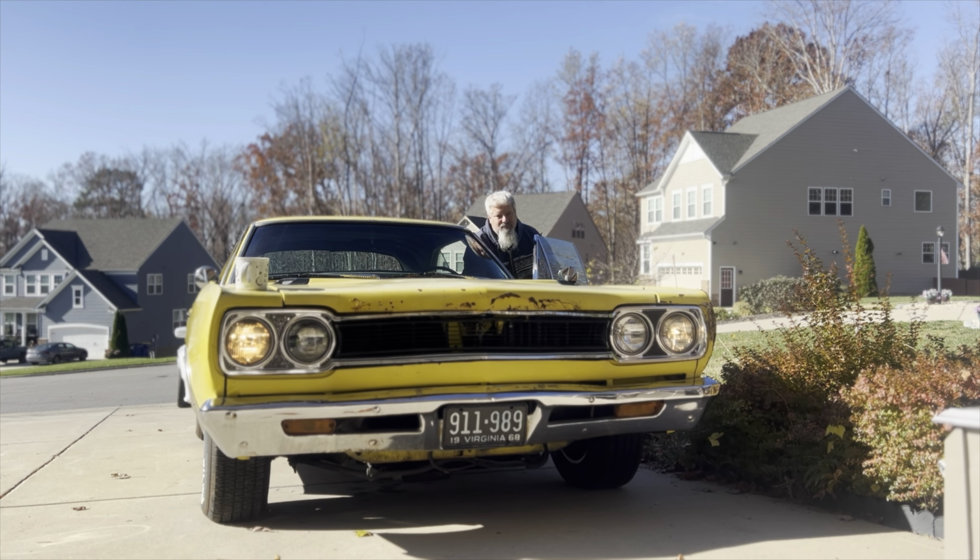So what's funny about this is when I got the car, this headlight was not even plugged in. The driver's side low beam was not plugged in. Plugged these in and I had some lights, but it still wasn't working right. Well, come to find out, two of the tabs on the driver's side low beam are broke off. So that was kind of causing a short. Also, whenever I went to high beams, the passenger side low beam would just cut off. It's not supposed to. So that bulb was bad, but we also had an issue here.